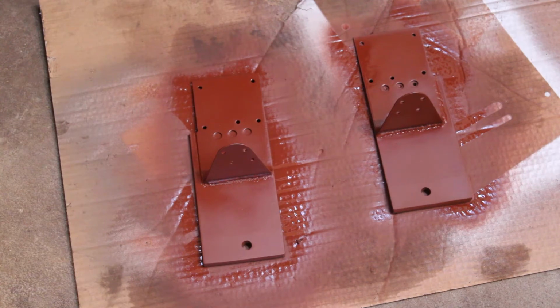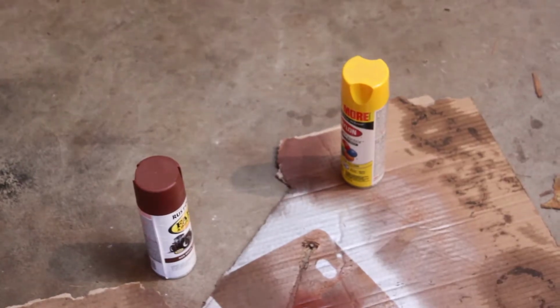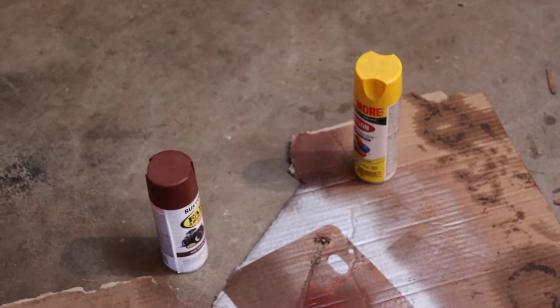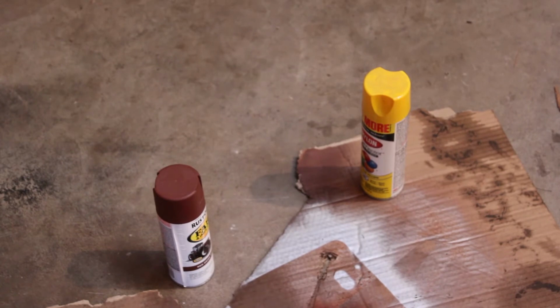So I got the drop brackets all welded up. There's an additional 3/16 piece of flat stock on the back side of each one of them that will close up the gap between the tunnel and the skid. I got the first coat of primer on there, I'll flip them over to the back side, and then I think we're going to paint them a nice shade of yellow. I think that'll match the machine pretty nice. If not, you can always pop them back off and paint them black, but might as well add some flash to the old girl, I think.